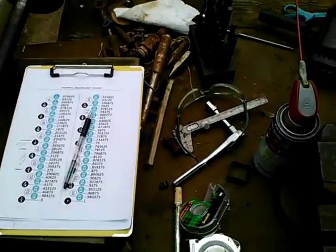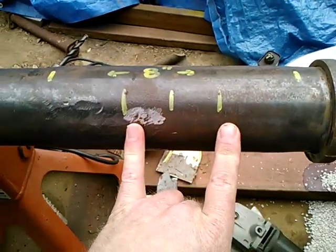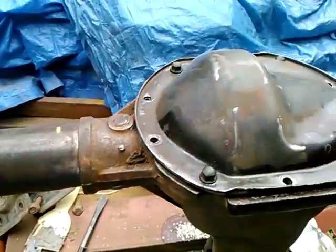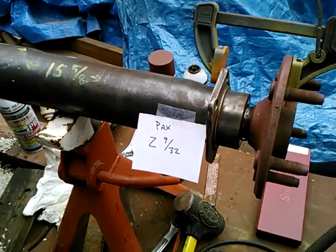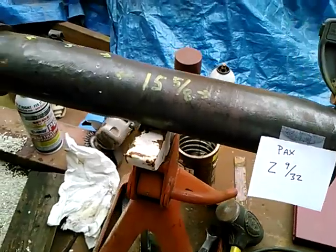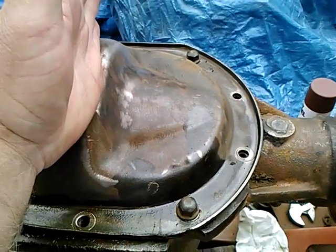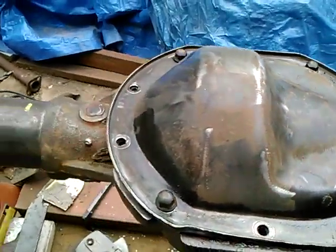And have proceeded to make some measurements and decided where I'm going to cut the tube here. Now, something that occurred to me in this process: the distance from wheel flange to wheel flange is not going to change with changing the width of the axle housing. Both axles bear against the cross pin inside of here, and that flange to flange length is therefore fixed.